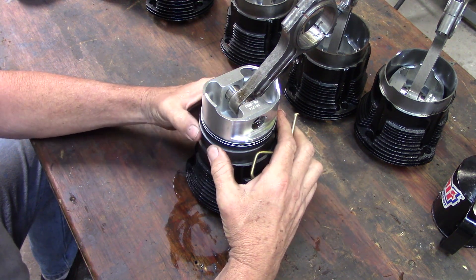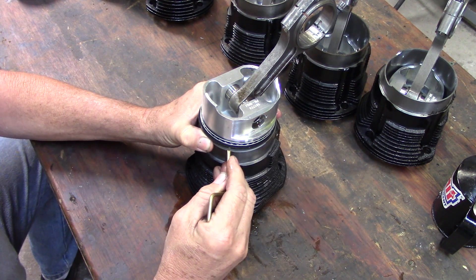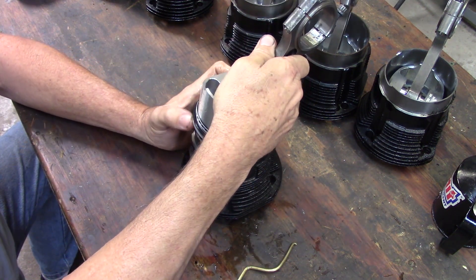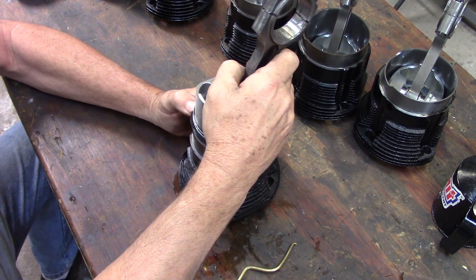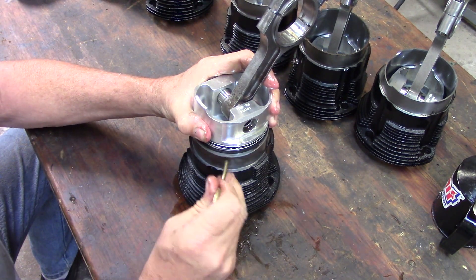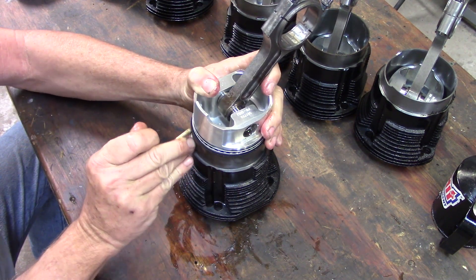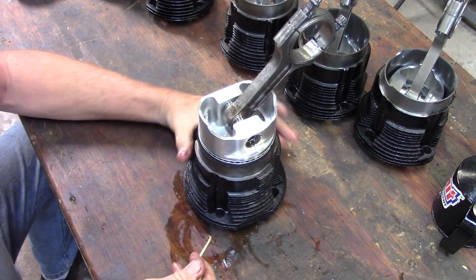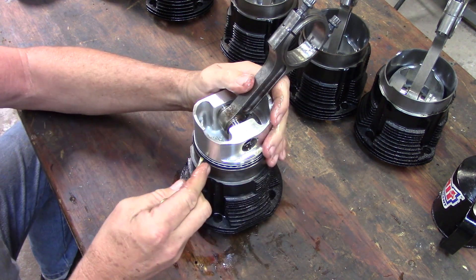All I'm going to do is just coax the rings into the bore, and I am going to be pushing on them only with the brass tool. You've got to pick a side you want to start on — it's sort of like mounting a tire. You're going to start one side and get that worked in, and then come back here and push that one in. As you see, the first ring, the top ring, has already gone in.